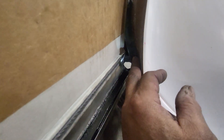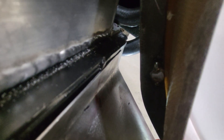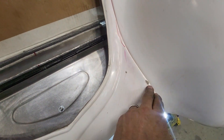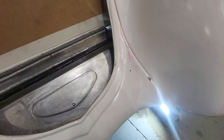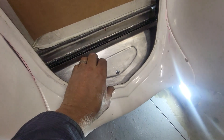I wanted to pinch it nice and flat — I didn't want the bolts to pull through. So I copied the shape onto a piece of 12-gauge, plasma-cut the pieces, and welded the heads of bolts in. You can see the spot welds right there. Getting them in was a challenge because you're going up underneath here — it's a bit fiddly. Then I quickly rolled up a pan to fill this area and direct the airflow up.